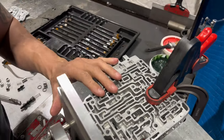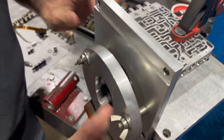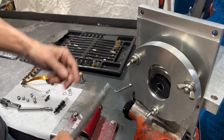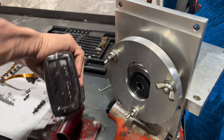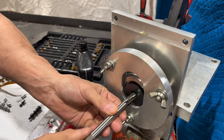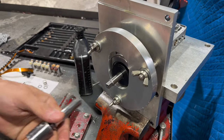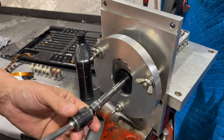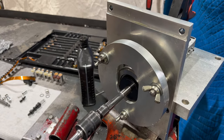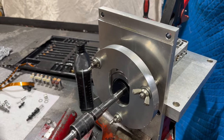All right, we have this set up, and this is a special fixture for doing this job. It has a little pin that you locate into the valve bore, and you're going to tighten this all down. It's got a spherical bushing in here. Now we take the guide pin out and we're going to ream it. Oil up the reamer and the bore. This is all real precise stuff — very delicate in the fit. Some people use drills or whatever, but I like just a speed handle with a little ball joint on it, and you just slowly turn it clockwise. Once you get to the bottom you're going to feel it and it's going to stop — that's how you know it's done.